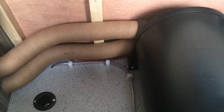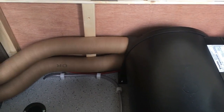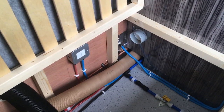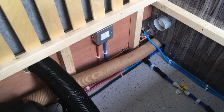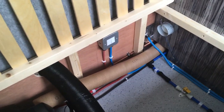I've taken the top connection and put that into the cab area, because Truma say that the two top outlets are slightly warmer than the two bottom outlets. So what I've done is run the top outlets to where they're needed most — the coldest areas. The top outlet on the left-hand side goes to the cab, and the top outlet on the right-hand side goes right the way through to the back garage and rear doors, because I know those doors don't fit perfectly and there'll be a few drafts. Also, the hotter ducts should be the longer runs, because by the time the air gets there any heat lost in the ductwork means it'll arrive at a similar temperature to the shorter runs.